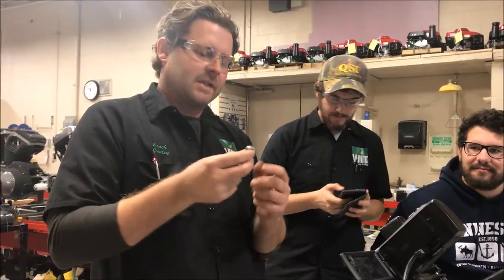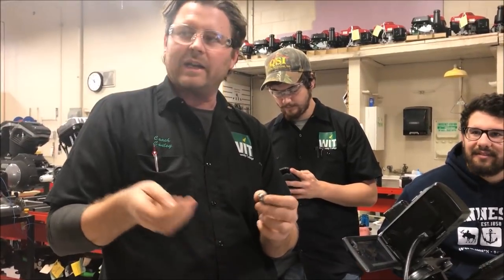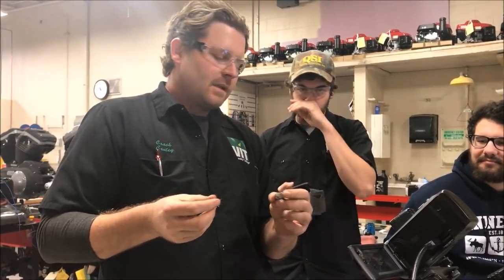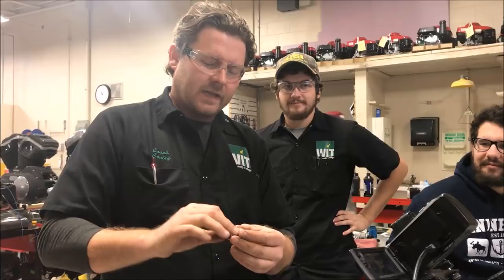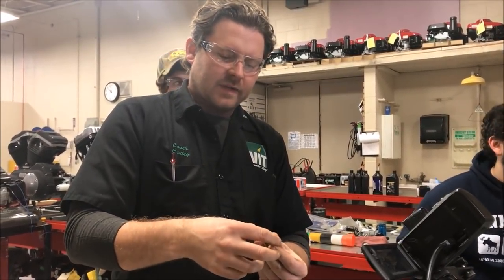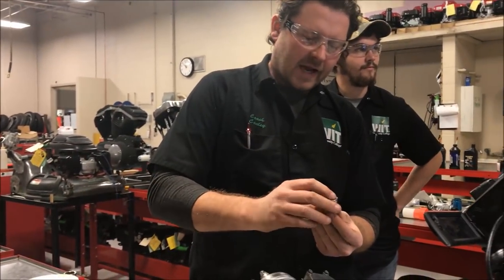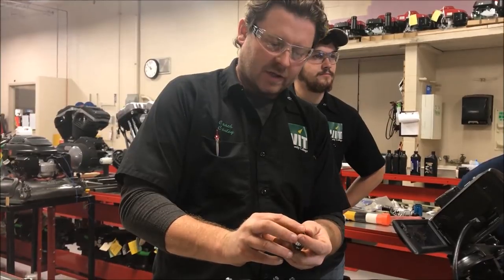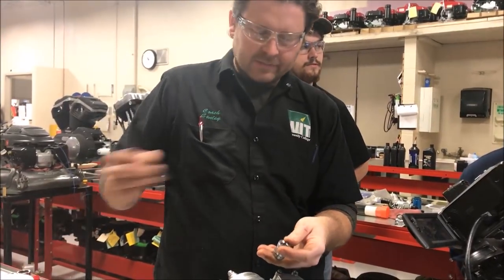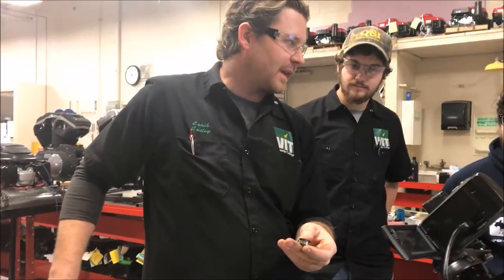The video I watched must have been a sealed bearing because it worked up really fast. But we got creative and we didn't give up. We decided to go ahead and pack the bearing itself, throw a washer over there — that wasn't even enough — and then just kept thinking about it. Put a socket over there and with some thumb pressure I was able to drive through and walk it up.